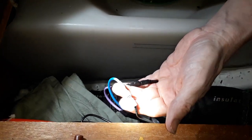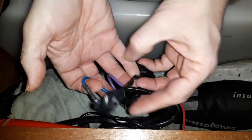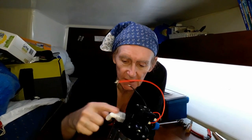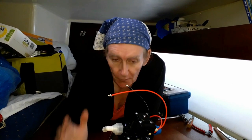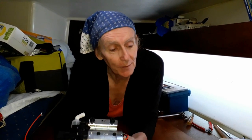Okay, that one's in. As you can see with the wiring, we think this pump has been replaced or at least worked on at some point in the past because the wiring side looks a little amateurish — not the sort of thing we'd get from Bavaria. It means we can unplug it without having to cut the loom. One thing we did before removing it was confirm that the fitting on the high pressure side does fit this pump. So we can safely remove the old pump knowing the high-pressure fitting is good, and we're hoping the low-pressure fitting is equally good. Everything else in the pump appears similar — including the rubber feet.